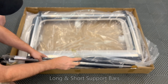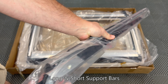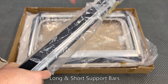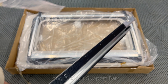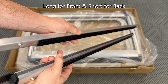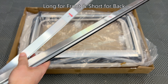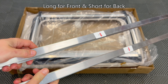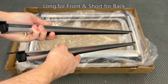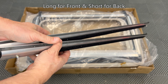Also underneath are these long bars inside plastic bags. On one side there is Velcro for attaching the trim panels. They have a U shape and screws are pre-installed on both ends. On the other side are labels with arrows. The arrow points towards the back of the car when installing. On the ends are black plastic tabs that will get inserted underneath the headliner on the inside of the roof.